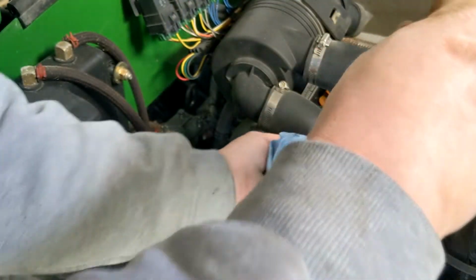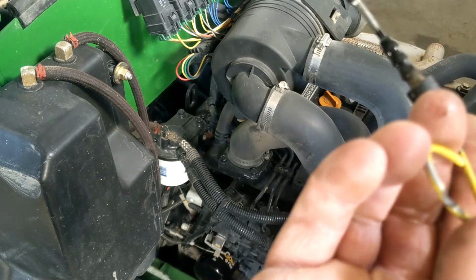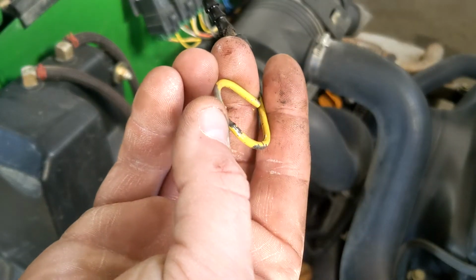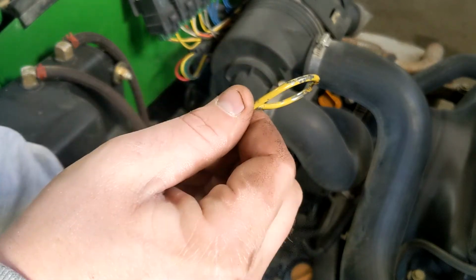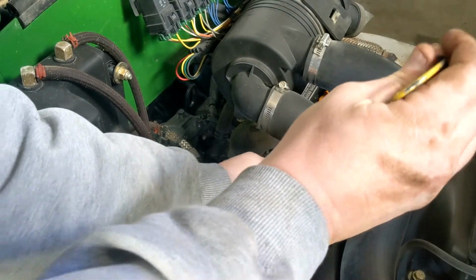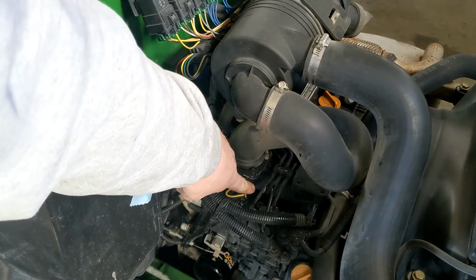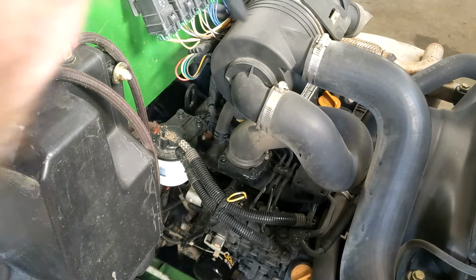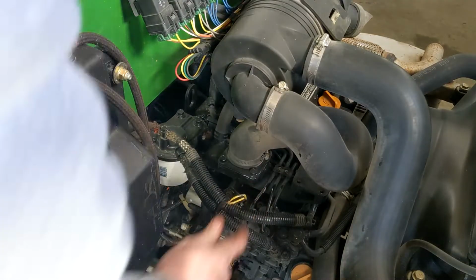So, one thing to watch on your 997s or any EMR. You guys see where that's been rubbed? This thing won't focus. See where that's been rubbed? I had been putting the dipstick in that way, and it was rubbing on the injector line. So if you put it in the back way, it sticks over here towards these, doesn't rub. You guys can probably see on the injector lines where it was rubbing. I'll probably just have a shitty day someday and those holes will blow out. They didn't really rub through, but they rubbed the paint off, and once they start rubbing, sometimes it's a bad deal, but I didn't catch it soon enough.